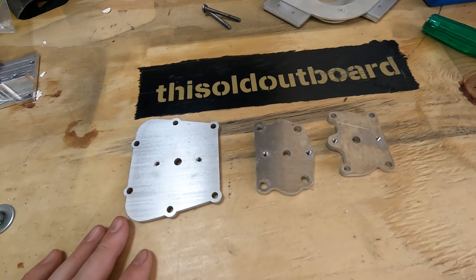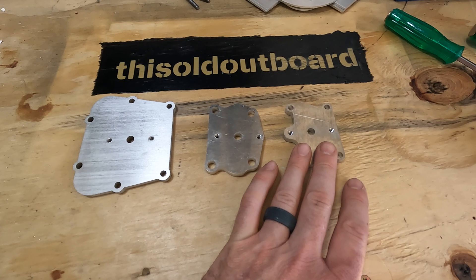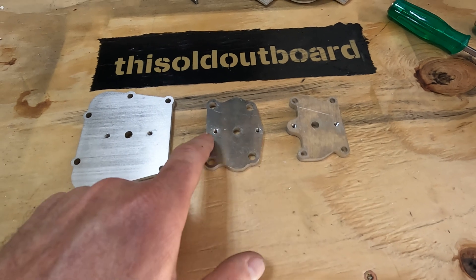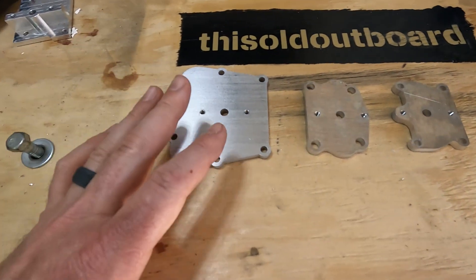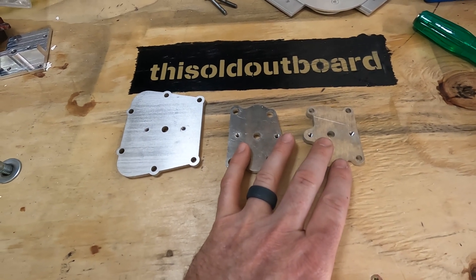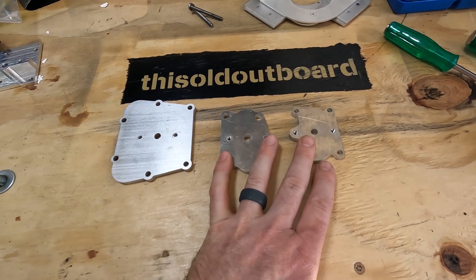Here are the new designs for the 18 horsepower, 7.5 horsepower, and 15 horsepower motors. You can see they match the OEM profile as well - same thickness, super low profile. These are the pressure points; these are number 10-32 fasteners and I made sure to get plenty of threads of engagement. The 25 and 30 horsepower plate didn't change much because it's always been this profile - I've just now been able to make these affordable, which is really the big issue. I'm excited to introduce these.